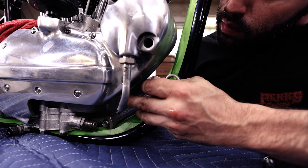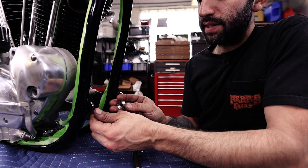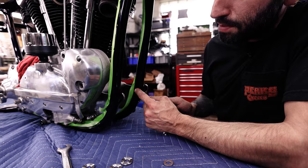Now for these plates. So this part of the spacer with all these ribs is actually supposed to sit against the slot of the motor mount plates that you have, and that actually keeps it from shifting on the slot. And these tubes sit against this side because this OD is supposed to be the same size as this OD of the bung that passes through.